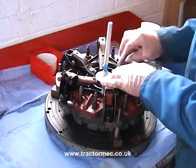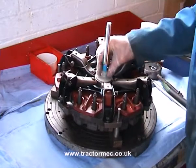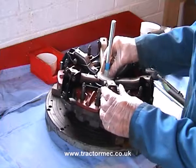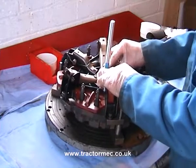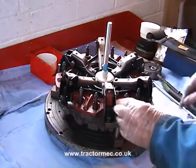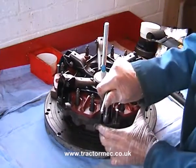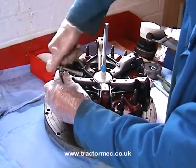Now what I've done here — I've just modified it slightly. I put some insulation tape around there because this plastic jar stopper seemed to be wobbling about a little bit on the threads; it would actually go into the trough of a thread. So we've just wound some tape around there just to make it a tighter fit so we get more accurate centralisation. And so now we can just spin up these set screws here holding the clutch cover in place.